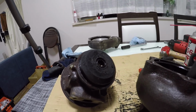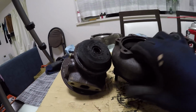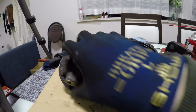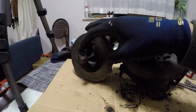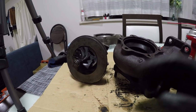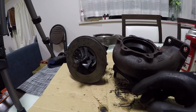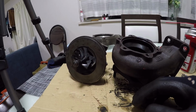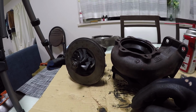So we're going to fish the rest of this out of the exhaust later on in this week when we start mounting things up with the new turbo. But this wasn't an overboosting issue. This was my impeller wheel breaking, probably something getting in the intake, which blows my mind because I have a pod filter and everything. So I don't know, we'll fish through everything in the front of the intercooler, see if there's anything there. But this just goes to show that, glad I've got a pod filter, and I'm glad I have an intercooler that's going to catch all that.